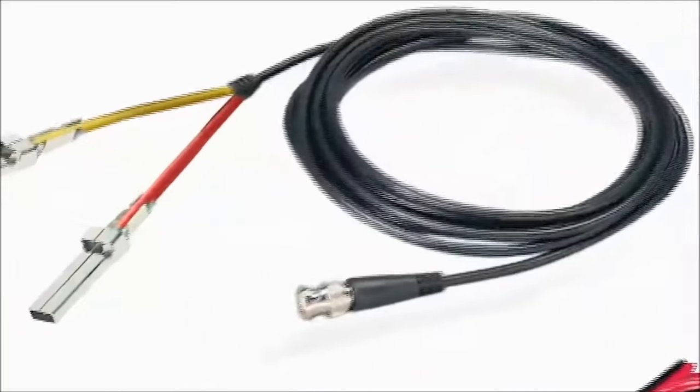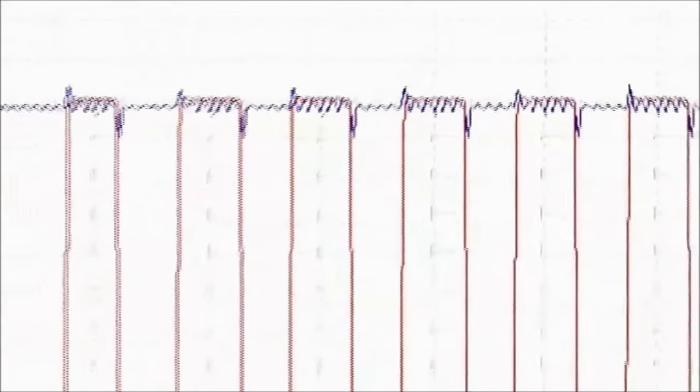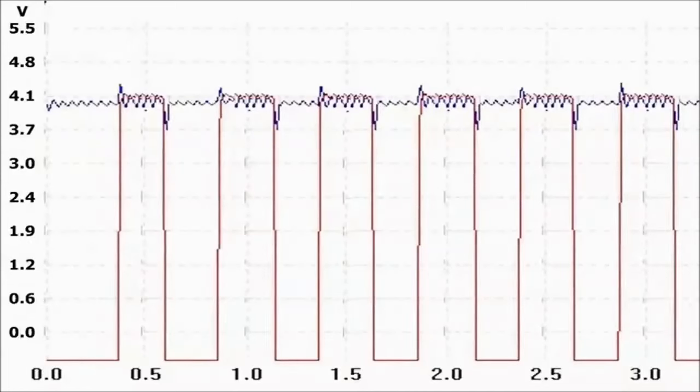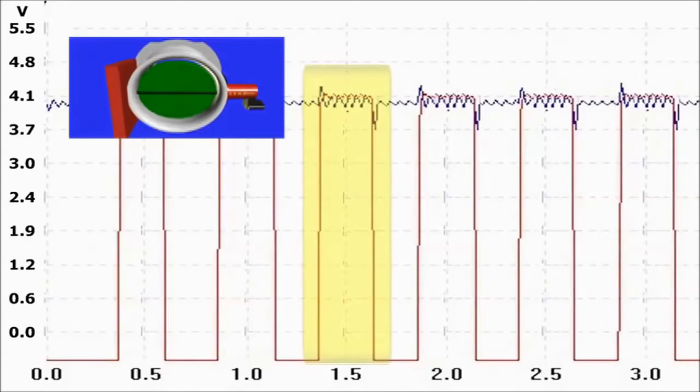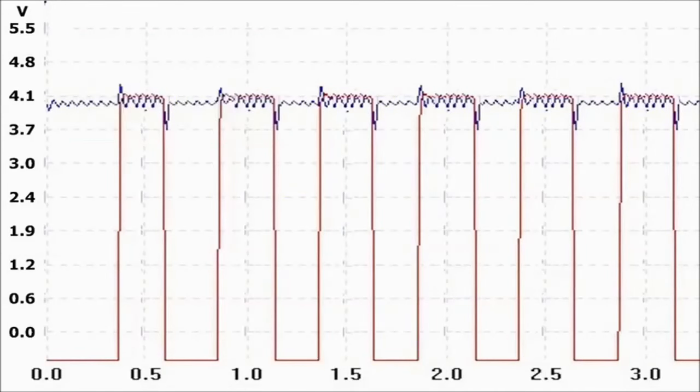The drive-by-wire motor actuator controller creates the duty cycle control signal to act against the spring load. So, in slow motion, the pulse pulls open the throttle valve, then it closes again due to the spring action, then the second pulse pulls it open again, and it closes again. But in reality, this happens so fast that the throttle valve stays open a specific amount of degrees. The wider the duty cycle pulse, the wider the opening.